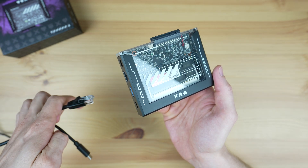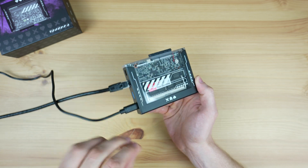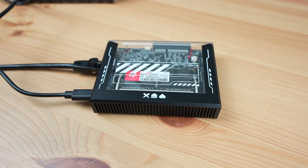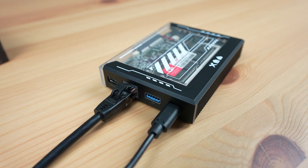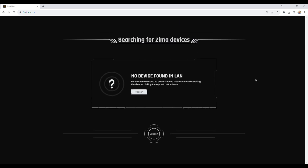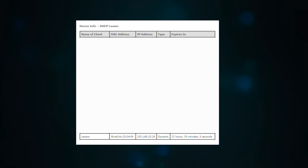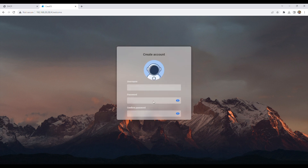To do this, we just need a network cable and the included power adapter. There's a tiny red power LED on the underside of the board, but it is quite difficult to see through the case, and the network port doesn't have any activity LEDs on it. We'll give it a couple of minutes to boot up and then find its IP address on the network. They have created an online tool called Find Zima, which searches your local network to find connected Zima boards and Zima Blades. This doesn't yet work on this early version of the firmware, but I was able to find the IP address by looking at my network's DHCP table. We can then type the IP address into a web browser on the same network and create our login to CasaOS.